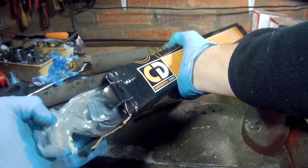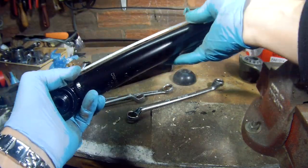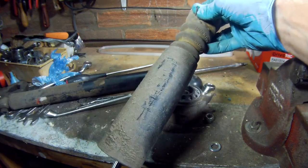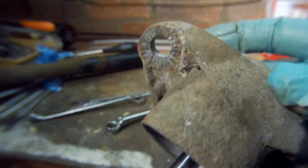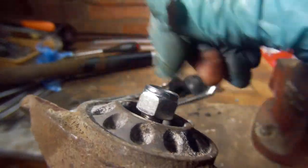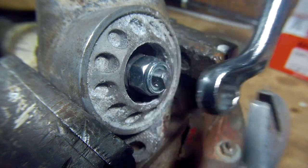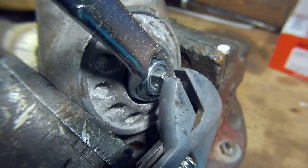Take the new shock absorber out of the box, and it's always good practice to marry it up with the old original shock absorber to make sure all the dimensions are the same. As with this bottom pivot bush, it's a different style but the width is exactly the same, so that should work without any problem. Slip the bump stop over the shaft, then put the top housing over the piston rod and assemble with the newly supplied lock nut, which I've set in the vise to make it easier to assemble, keeping the body of the shock absorber free to move. We can tighten the top nut to the specified torque, which for this particular car I'll leave in the description, but always check against your own car's specifications.